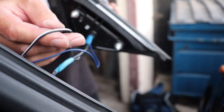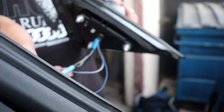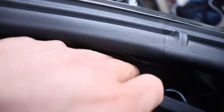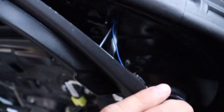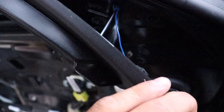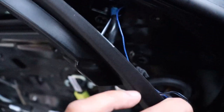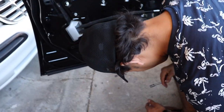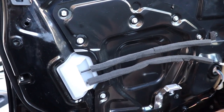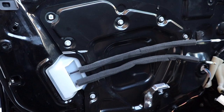Having fed the wires through the mirror assembly, we're actually going to fish the wires through the door now and install the mirror back into place. At this point you're dealing with three wires. We already hooked up the black and red wires for the sequential turn light signals. You should be working with blue for DRL, white for the puddle lamp, and black for ground. To know where we'll tap into power, I'm going to remove this access panel — it's got eight 10mm bolts and should come right off.